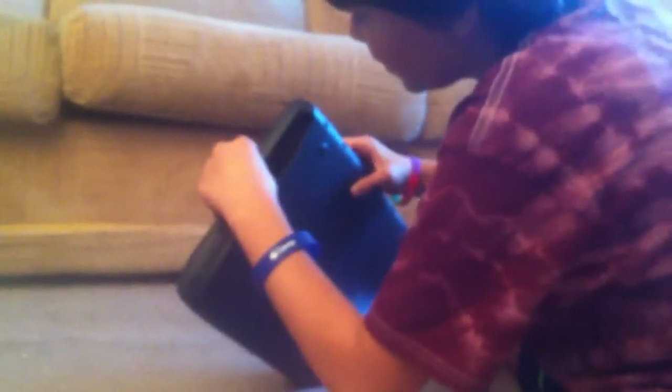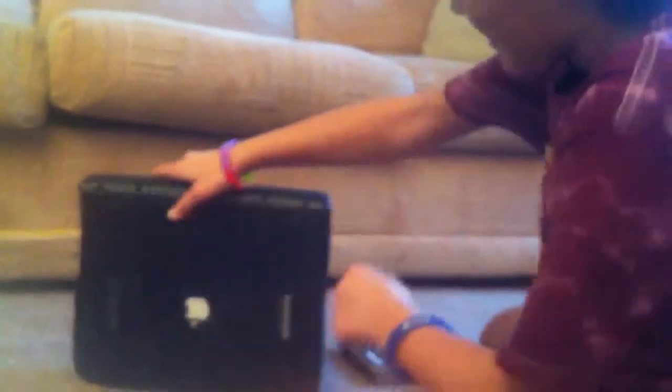So you remove the two drives and the battery by removing these things. And then, once you remove the drives, underneath it in here there should be two little tabs that you pull back. They're towards the back of it, not in the front — they're black. You just pull them back and you'll hear a little clicking noise because the keyboard will be released.